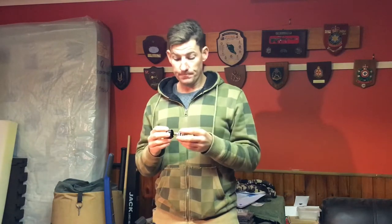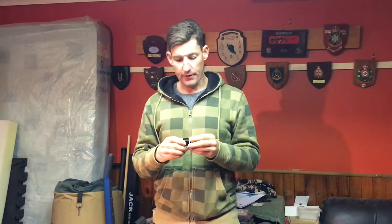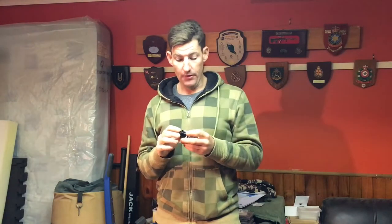It felt to me like the negative spring is too big with the Luftcap installed — the Evol already has a bigger negative air volume, and this felt too big relative to the positive side. The whole time I had it in, I felt like I needed to take a token out. So once I went back to normal, I ran an extra token as an experiment — going to two tokens — which confirmed what I was thinking: two tokens in the standard Evol made the fork feel almost identical to how it felt with the Luftcap.